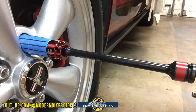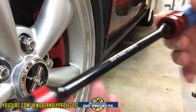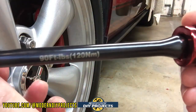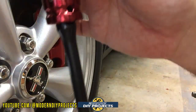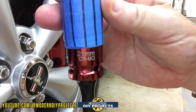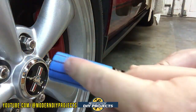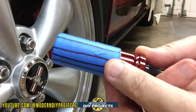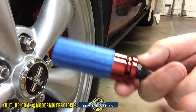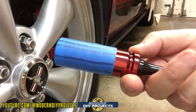So let's do a little testing of these torque sticks and see how they perform. Let me explain the process: I'm going to be using the 90 foot-pound torque stick and the 21mm socket, which is the one that fits my car. I put painter's tape on the socket and drew some lines on it so you can see the movement as we go through testing — the lines are just indicators of movement, not precision markers.